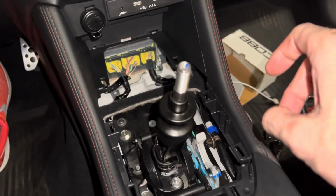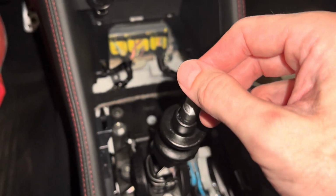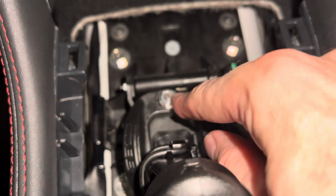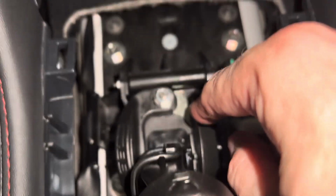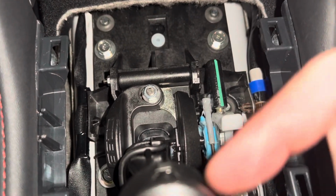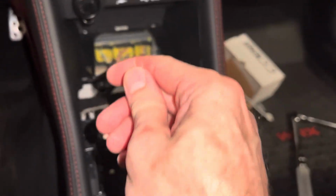Okay, quite a process. I'm not gonna lie, that was probably 20 minutes-ish screwing around with loosening these guys, moving it, thinking I moved it to tighten when I tightened it, or thinking it stayed in place when I tightened it. What I found, this guy likes to walk when you tighten it. I think the channel in here also gets bound up on the nut that's holding the reverse lockout in. Anyway, what I ended up doing is just moving it all the way over, and I'm sure it's different because this is the STI short throw, so maybe it's different for other folks. I ended up moving all the way over, holding it in place and tightening these guys down, and maybe some people want it tighter than this, but I think that's pretty good.